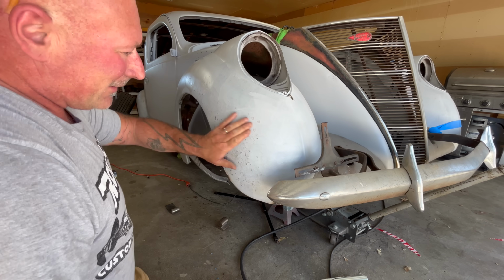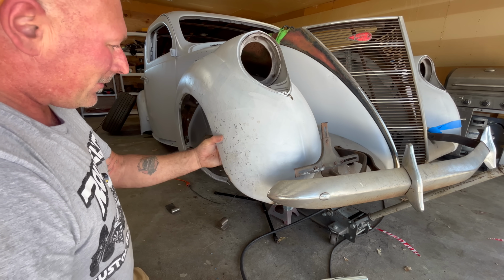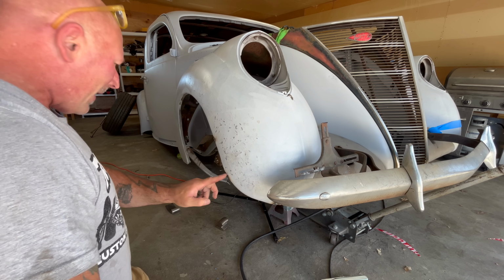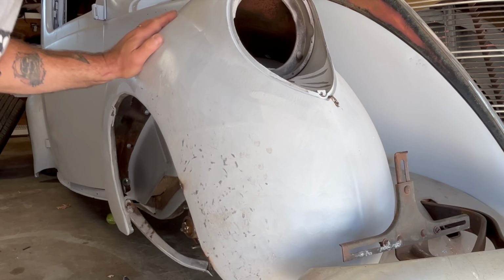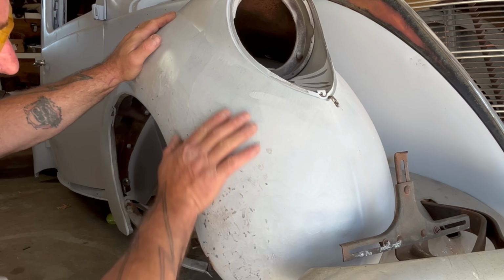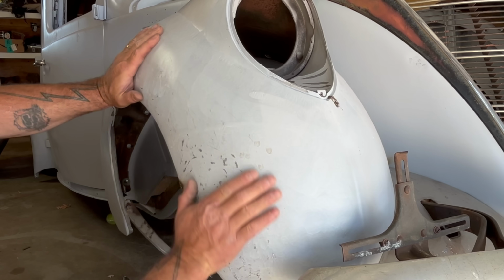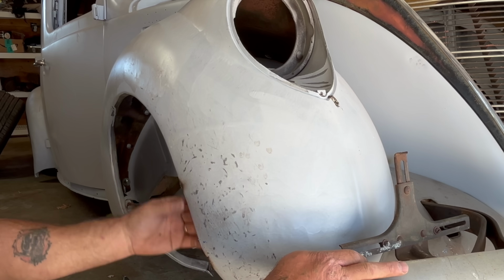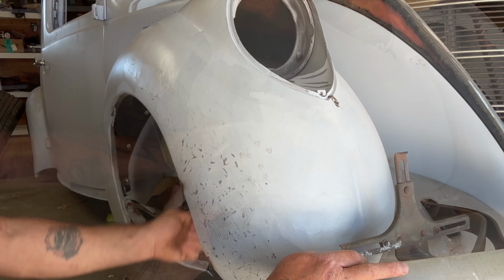A relatively even contour. Let's go ahead and make that air tool and see if we can't just rattle this into shape just a little bit more. I'll cap this with a weld, and then we're good. I'm gonna change that last statement. You can see how close all this is. I am cool with that. A little more hammer and dolly work, but filler will take this out. This is really close. I'm gonna weld up these ends here, and that's gonna be it for this front end repair.